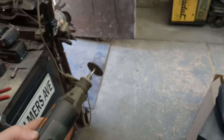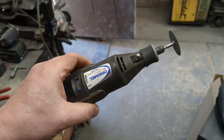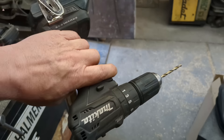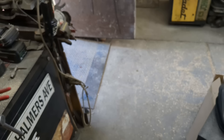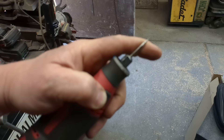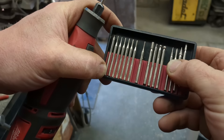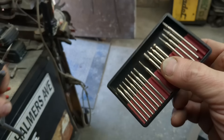There are only a few basic tools you need. One is a drill or a Dremel — a Dremel is preferred. I'm gonna use this cordless Milwaukee Dremel tool because it spins a little bit faster, but you can use a regular corded or cordless drill. We're going to use these little diamond drill bits. They're meant to go into a Dremel, they're eighth inch, but you can chuck them up in a drill. A Dremel just spins way faster, so this is gonna be a way faster method.